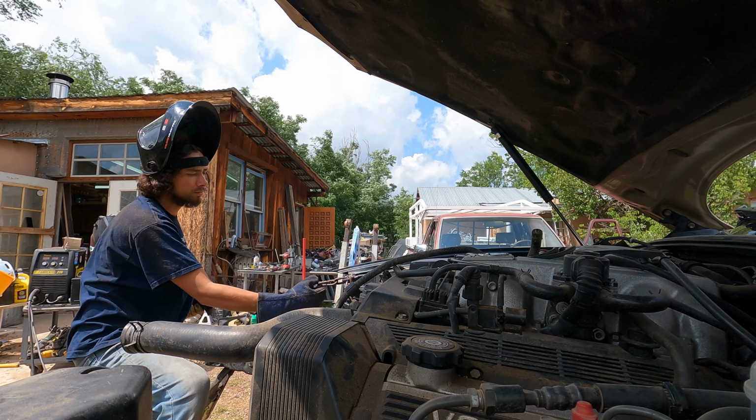I've gone ahead and welded our frame reinforcements in. Welds are better than I did on the Tundra exhaust. It's really hard to weld thick steel to sheet metal. Now we have a good solid landing point to drop our bar for our core support and wrap around here. I'm gonna go ahead and do some tests. I'm gonna try taking out pie cuts, a pie cut here and a pie cut here. And I'm gonna see if that will allow us to bend and weld a 90.